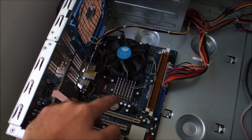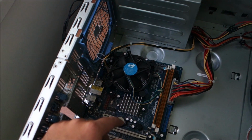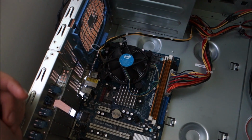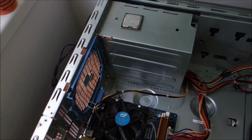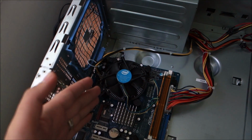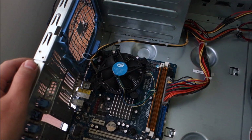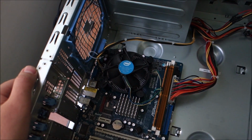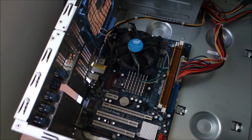But before trying to update the microcodes, I just realized that I have another Fujitsu Siemens server that you can see in one of my other videos, that actually has a socket 775 Xeon similar to this one, so that one I could put in without even needing to modify the socket, but the socket is already modified, so yeah. But I'm going to try and put that one in to see if something different happens. And if it's still the same even with that one, then I'm going to modify the microcode and see from there. So let's do that.